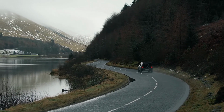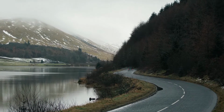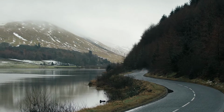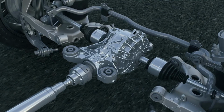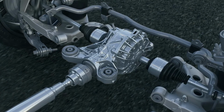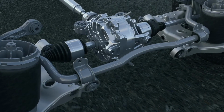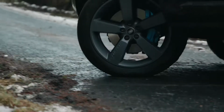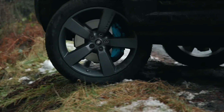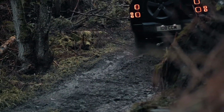Let's start with the Driveline and Dynamics hardware, where there are some key changes. The first is a major enhancement to our active rear differential. This adds yaw control alongside traction improvements. We've also introduced larger diameter solid anti-roll bars, along with revised spring and damping rates. None of this changes the effortless ability of Defender on or off-road. It's still awesome, especially over rough or broken surfaces.